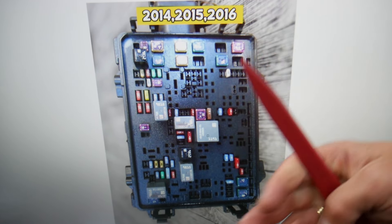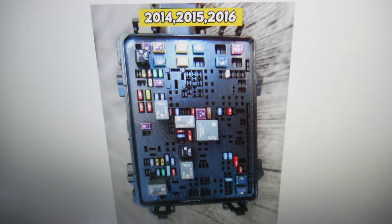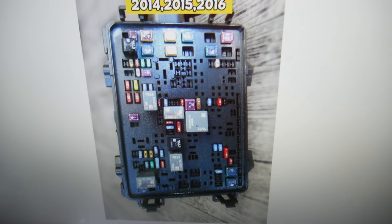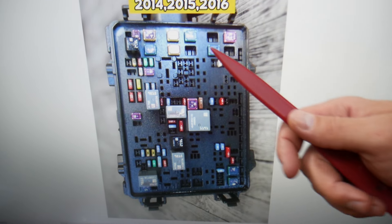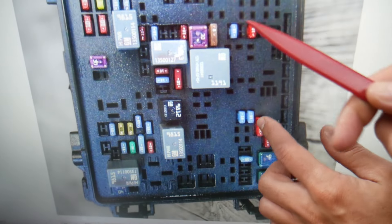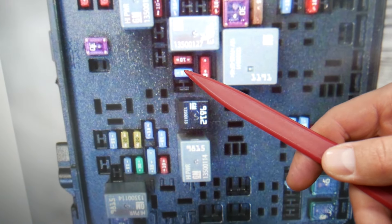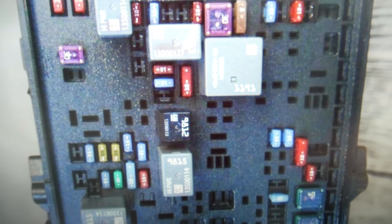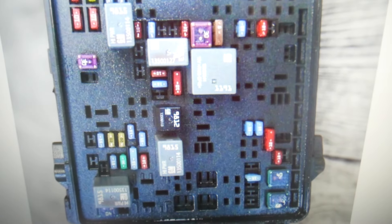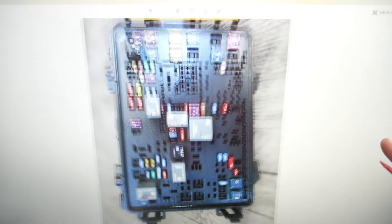Please make sure you stay till the end — we want to give you one good piece of advice so you don't end up stuck in the middle of nowhere. For the 2014 through 2016 models, if we zoom in and come into that section right here, you'll see a relay. Under that relay, the second fuse is known as fuse number 40 — that's the one you need to check. Then you need to check fuse number 58, which is a double fuse — a Micro3 fuse. We'll put a link in the description where you can buy it.